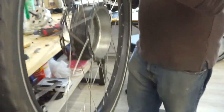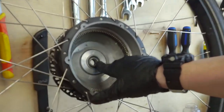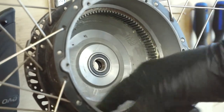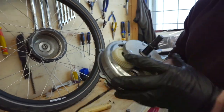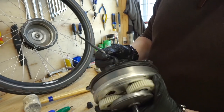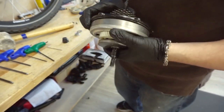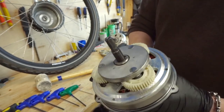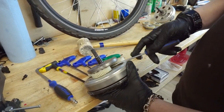A preliminary examination of the inside of the motor core is always a good idea. Take a look at the bearing condition — is there rust? Is it spinning freely? Is there lithium grease on the outer gear arrangement inside the motor core? That all looks good here. This motor just had a new planetary gear installed, but the motor core itself was damaged in a crash — as you can see the wire harness is in need of repair, so we are going to replace it.